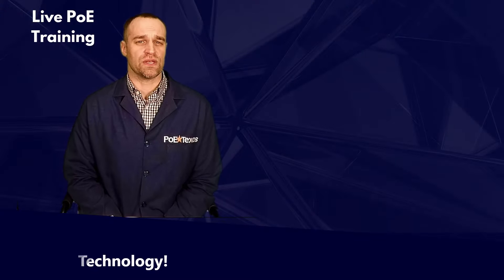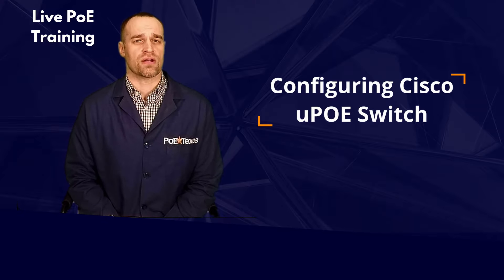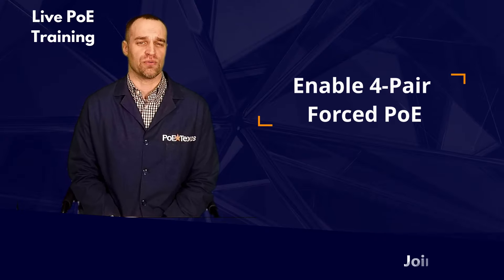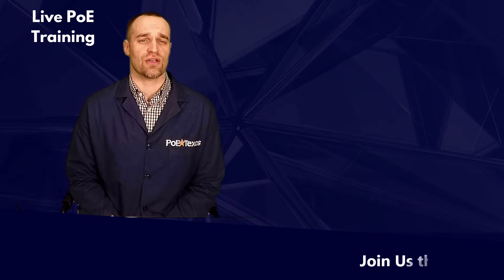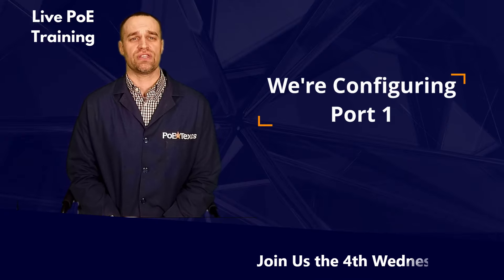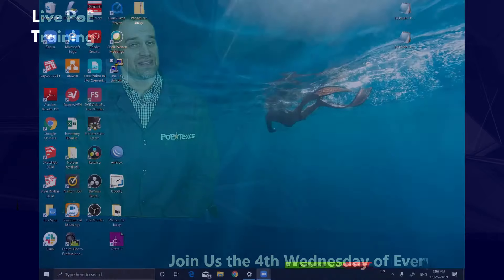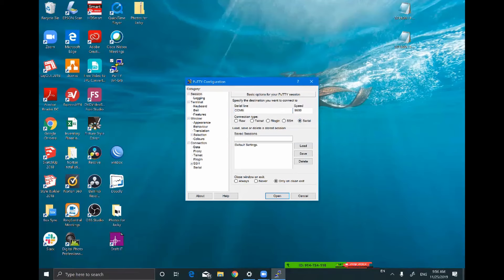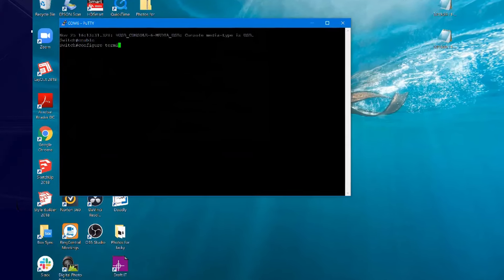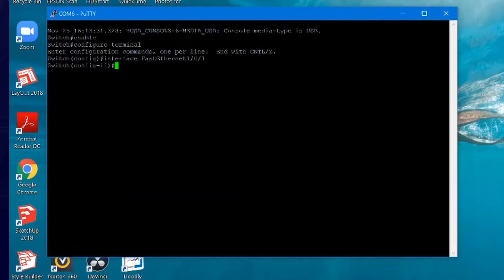If you're using a Cisco UPOE switch, you do need to configure the port to provide 60 watts of power to your NUC lid. Prior to powering on the NUC, configure any Cisco UPOE switch for four-pair force PoE mode. The following steps are for the Cisco CDB8U; however, the commands remain the same for any Cisco device — only the port identifiers change. Once you've logged on to the Cisco terminal and you're at the terminal prompt, follow these steps to configure port one to four-pair force PoE, which will allow the switch to power the NUC lid up to 60 watts. Call us if you need help connecting to the switch.